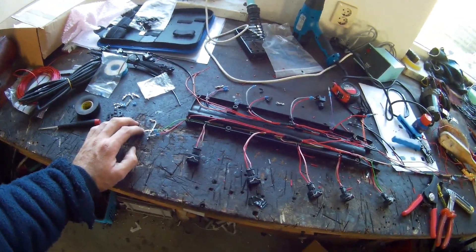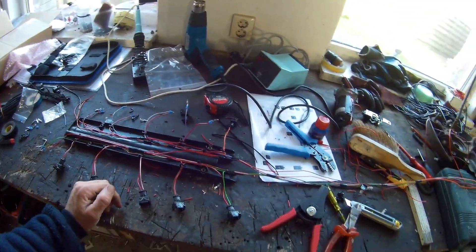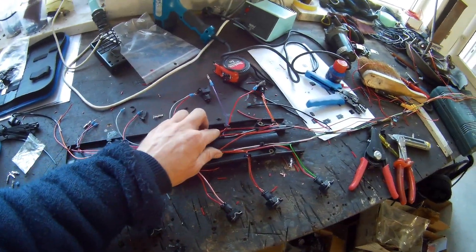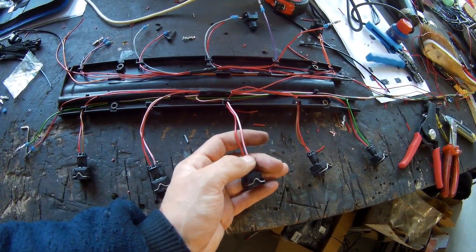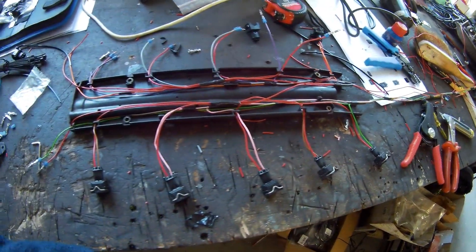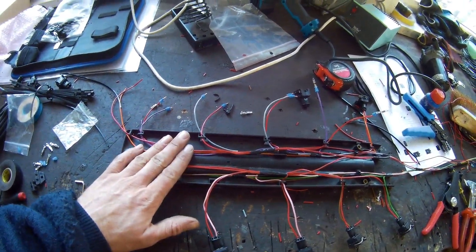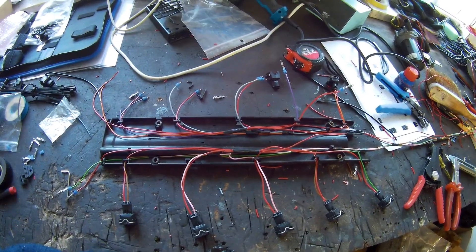When this is in the car, the front of the engine — where the flywheel is — will have coolant sensors and that sort of stuff, with ignition wiring on one side going back to the ECU. I don't think I'm going to put a cover over the injector wiring because it's easier to access for future electrical troubleshooting — you can see the wire colors. The wiring will be wrapped up nice and tidy, and there'll be a cover over it so you don't see it anyway.